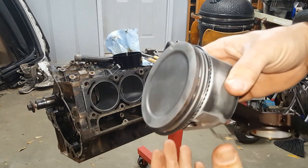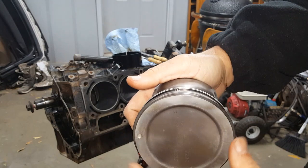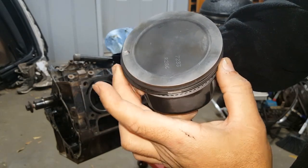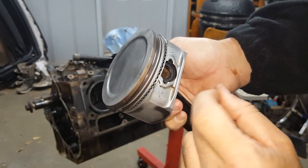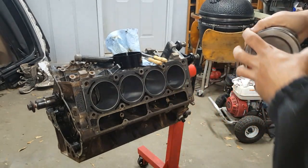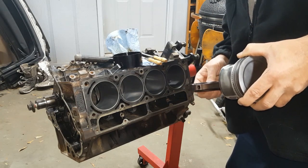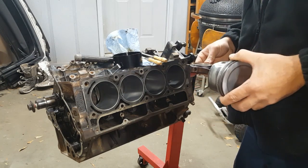All right, so I've got my piston back out. Remember, the pin goes to the front. I've got my top ring right there, my bottom ring down there, separate from each other. And I've taken the time to separate the oil scraper retaining rings. I'm not going to show you that because it's too fiddly. And I've taken a lot of time to get them right where I want them. Take our rod bolts off and our end cap off. I put assembly lube all over everything already, if you remember.